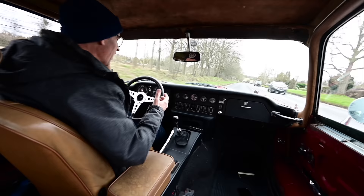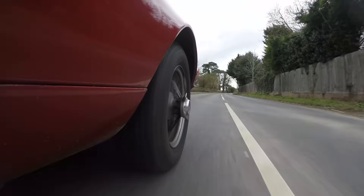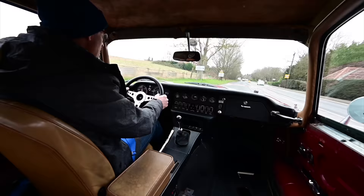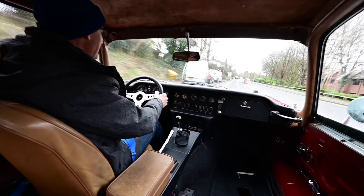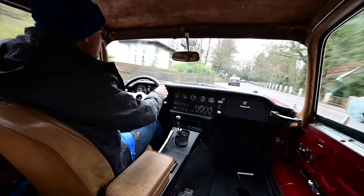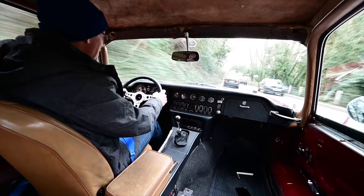I like an E-Type as much as the next guy. They're a fantastic classic, but they are almost a default classic as well — not one of the ones that makes me go weak at the knees, because you kind of expect to see one at every car show. They're great cars, but they're a little bit obvious. However, this takes everything to a whole new level. It drives so, so well. The suspension is worth mentioning too — it's uprated disc and pads all round, gas shocks all round, and in the front it's got what looks like coilovers but are actually helper springs surrounding the dampers. They've done a lot to stiffen up the ride.